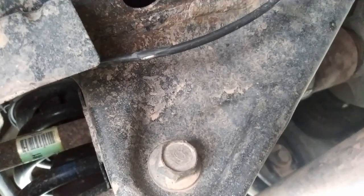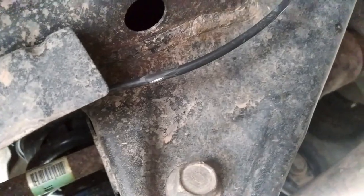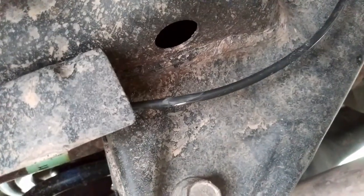After finding out that it was the right rear speed sensor that that code points to, I climbed under here and looked to trace the speed sensor from the wheel. It comes along to here, and you can kind of see that frayed wire. When I moved it around with my hand, I could kind of see copper wire, so I'm pretty sure that's where I have a fault in the speed sensor cable.